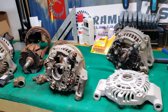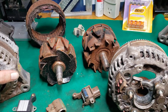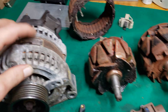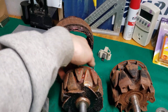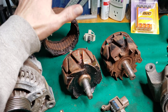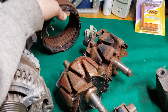Today's video is going to be on alternators. I'm going to start out explaining the basics and the big differences in alternators, which is the type of stator they have. This is a slot wound stator and this is a Denso hairpin stator. One of the big differences — see all these little pads here? These are the points at which it charges. See how much bigger and less dense they are on the slot wound? So if it's a slot wound, I don't even mess with it. It's an inefficient design, so I don't bother with it.